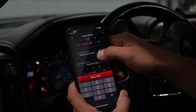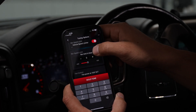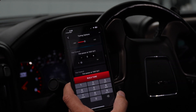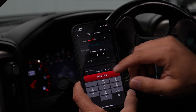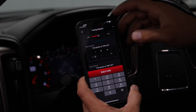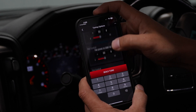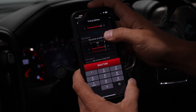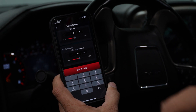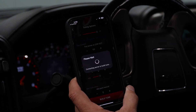You can also fine-tune the speedometer by checking against GPS speed. From there we can change our gear ratio, remove the vehicle speed limiter, and adjust our rev limit. We've got fan control, which lets you set the temperature at which the cooling fan comes on or off — useful if you do a lot of towing and need the fan on earlier. We've also got idle calibration adjustments. Once we've made the adjustments we want, we go ahead and select 'Build Tune.'